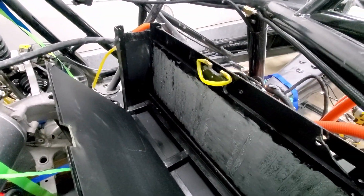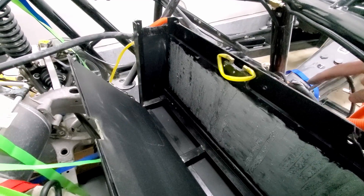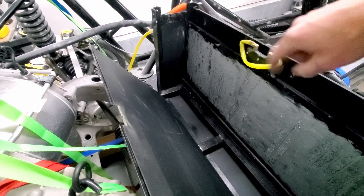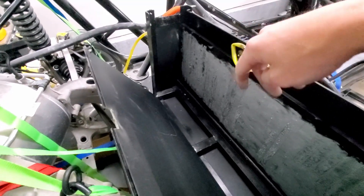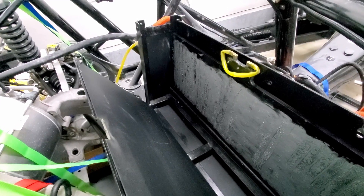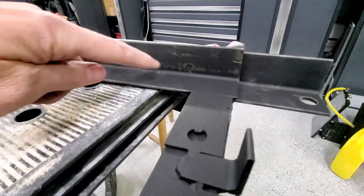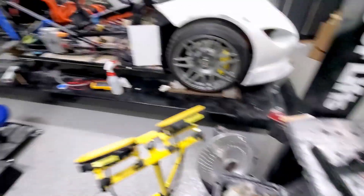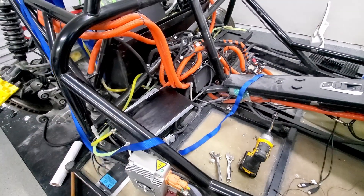I've got the rear plate back in. However, before I even tried to bolt it to things, I think I've just worn away enough of the anodization that it's kind of rubbing on the frame, and other places. But it's meaning before I even bolt it, we've got continuity between here and the frame. So I may just have to take it out and grind away, find some way to make sure it's not touching anywhere. We have the same issue with the bracket on the other side — as I was putting it down in place, it's just kind of scraping away some of the rubberized undercoating, so again it's making continuity. I'll just have to find a way for both of these to make that better.